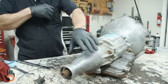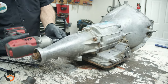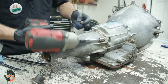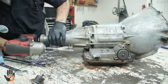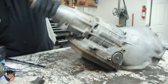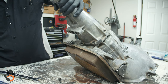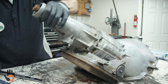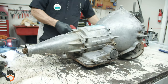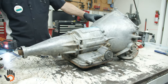We'll go ahead and take our tail housing, extension housing off here. One on the bottom. Pump's already falling off the front. There weren't any bolts in the front pump. So,